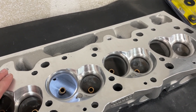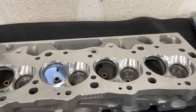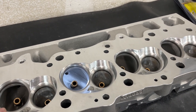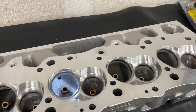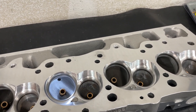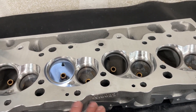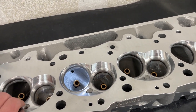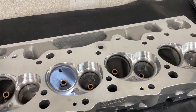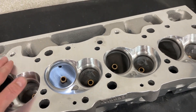This is the first new one — the smallest offered in the 3 Extra line at 327 cc's. I've been waiting for it because the next size larger is a 335 cc's oval port, much larger than a factory 454's, and not a lot of intakes work with it. For some engines, especially the 496, it's just too big. So they kind of left out people who needed a smaller head. I was dying for them to make this because it's a 24-degree valve angle, more modern design chamber. They finally made it.